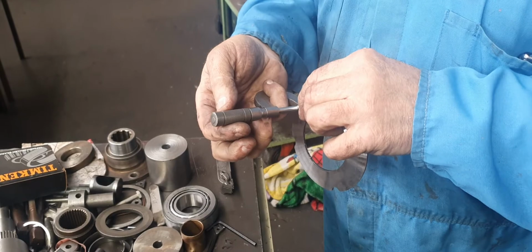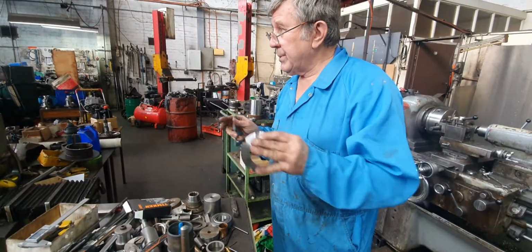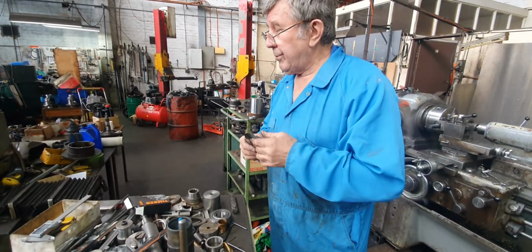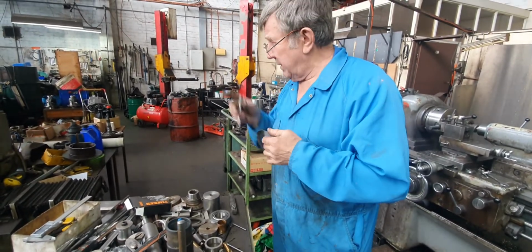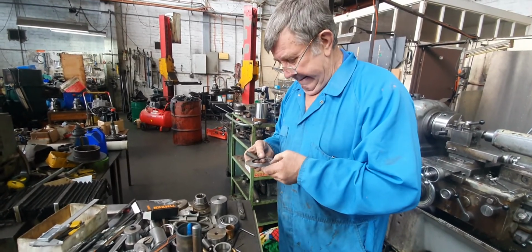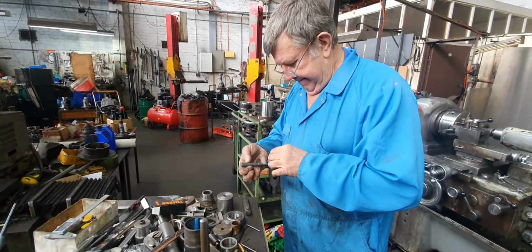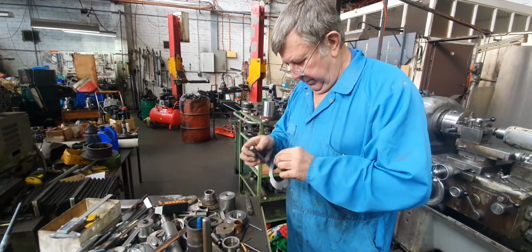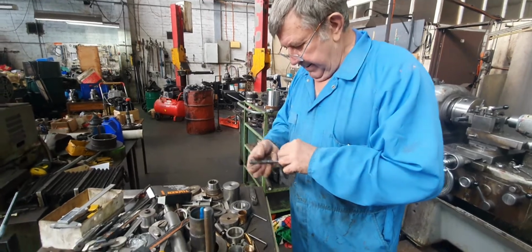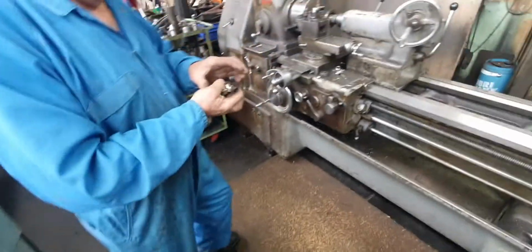2 thou, whereas you've got all the side gears all being in different positions to their own thrust washers and Belleville washers. They've got little Belleville washers under the side gears in this thing. 62, thought it would have been right on 60 there. Anyway, we've got the technology to make it exactly right. It won't take an extra couple of minutes, will it?